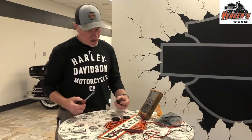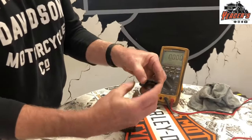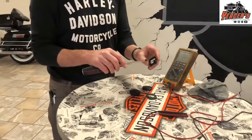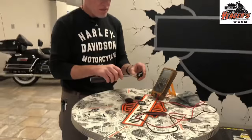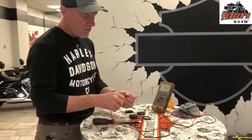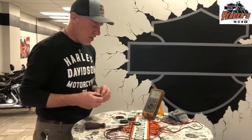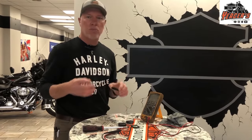So if you don't want to just put a new battery in it, what I do is take a small screwdriver or a dime and split that fob right apart. Open it up and there is the battery. Make note of which position the battery is in — the negative side on this fob is up. Take the battery out, set your voltmeter on direct current, and check the fob battery. It reads 3.02 volts, so that fob battery is good. It just gives you a little more confidence before a big trip — instead of replacing it, you can check it.